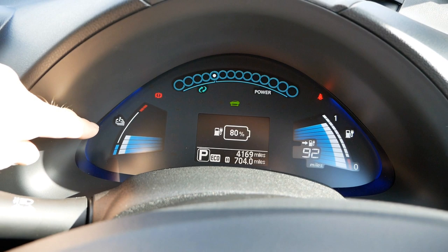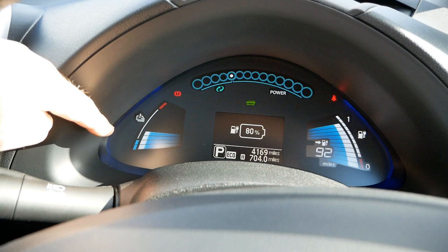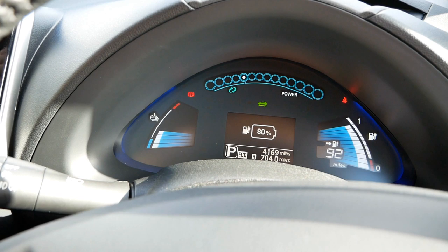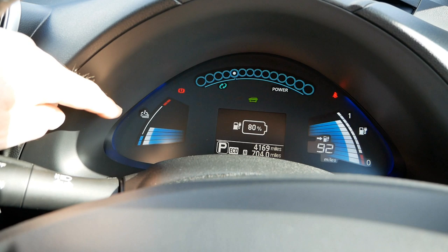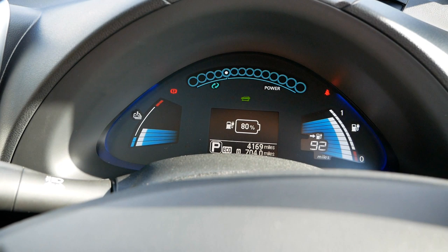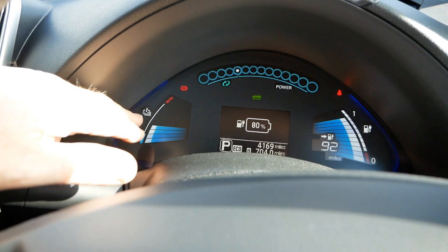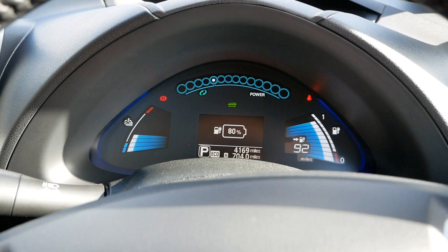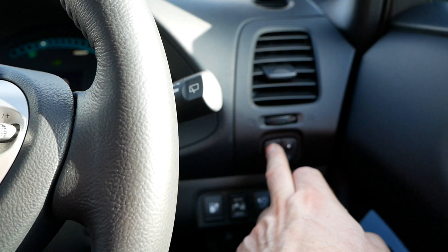The Nissan LEAF is the only EV that shows you battery temperature — you've got a cold end and a hot end. If you're doing lots of motorway driving, draining the battery quickly and then going into a rapid charge, the battery could theoretically get hot. If you got anywhere near the red you'd have to stop, let the car cool down, or skip the rapid charge and let the air cool the battery pack. In reality in the UK this doesn't really go up much — I've never seen it go anywhere past the middle. We also have the mileage and gears displayed.